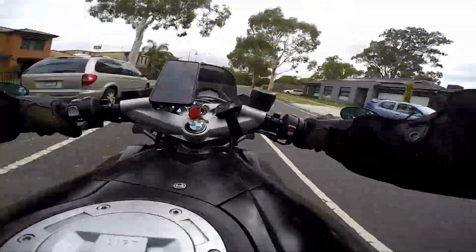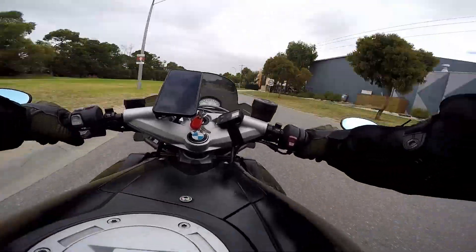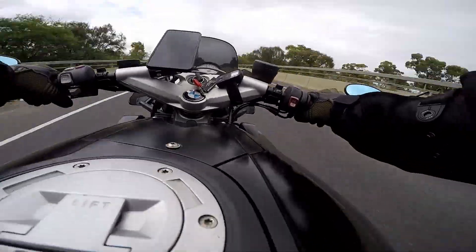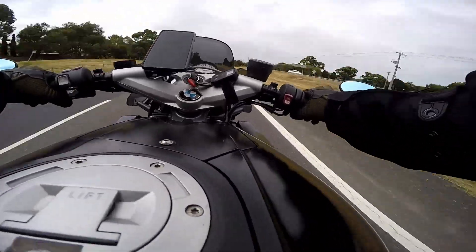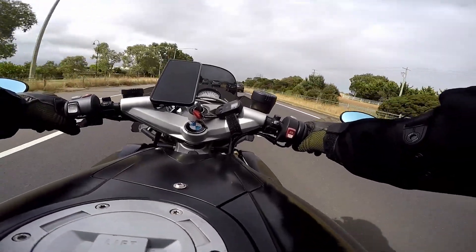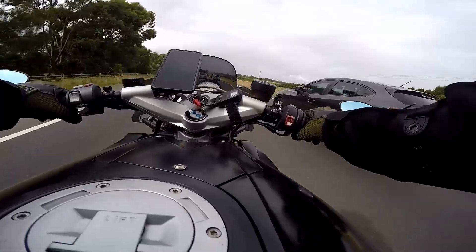Okay, so I have to say it's pretty good. I was backing on the throttle and off, giving it a very slight tug, then letting it sort of slap shut, then grabbing the throttle again — no snatchiness at all. There wasn't very much on the K1300 anyway, but there was the occasional snatch and it is absolutely and utterly completely gone. I think the booster plug is well worth the money.